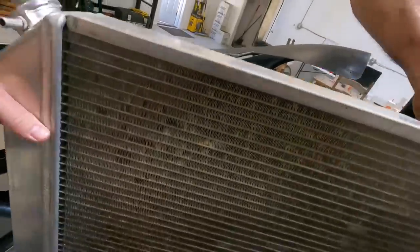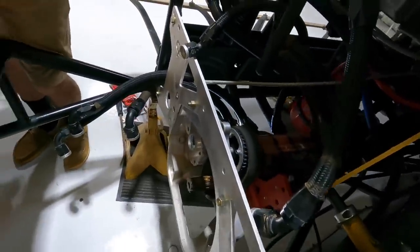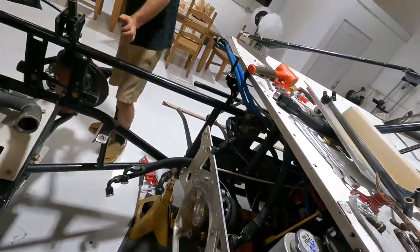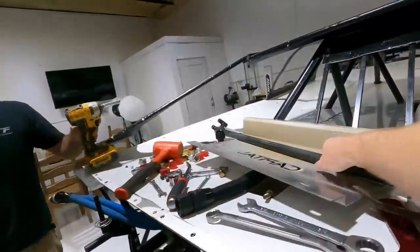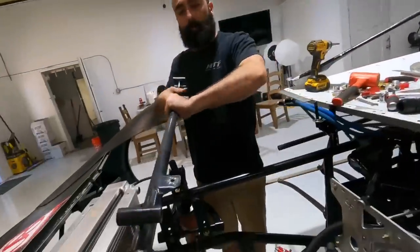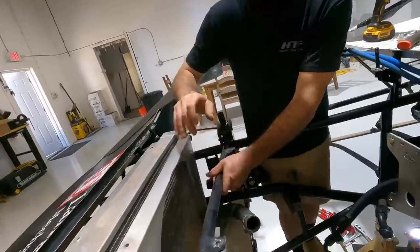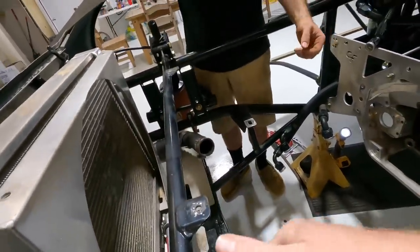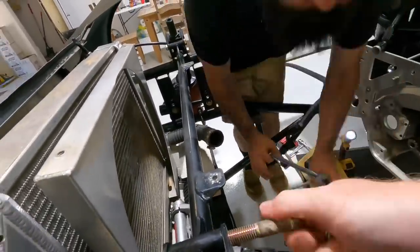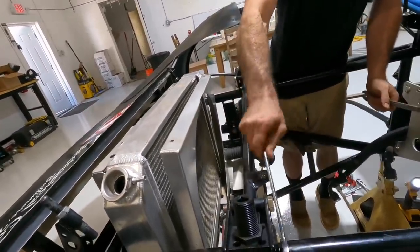All this has to go back together — radiators gotta go back. We're gonna make sure the transmission is bolted in, put all the bell housing bolts in, tie up all these oil lines, and put the body on it — new sides going on. I feel like we've gotten a little out of practice pulling motors. I'm glad we got away from doing it all the time. Oh hey, run that ratcheting wrench in there — oh, that'll work perfect.